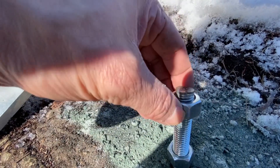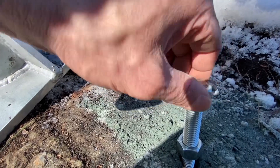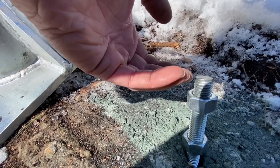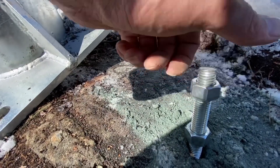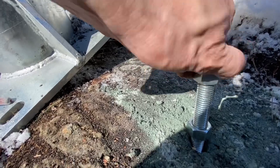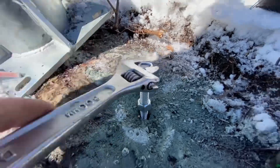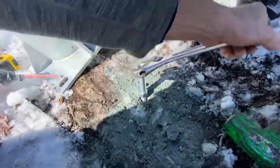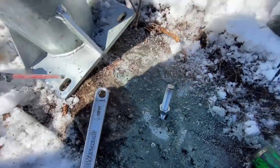You can see it got slightly mushroomed, and that's why I wanted to leave my nut on there. If this happened badly, you could use a side grinder with a zip blade and cut it off clean, but in this case it's not too bad. We can simply take a crescent wrench and pull off that nut — and it'll come off just like that.